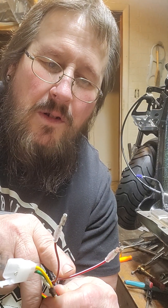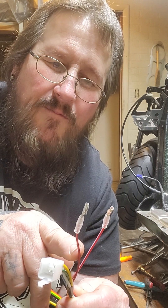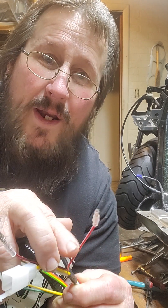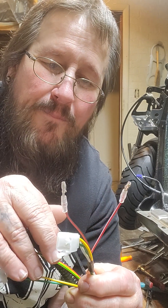Then you have your stator wires. The stator wires are black-and-red — that's the power for the CDI, and that's normally always black-and-red on the stator. Your pickup wire on the stator might be blue-and-white; you connect the blue-and-white to the red-and-white on the harness. Then your other three wires plug in if it's a three-wire, like a basic eight-pole stator.